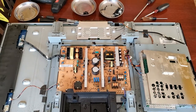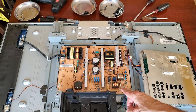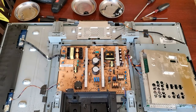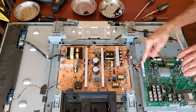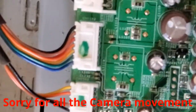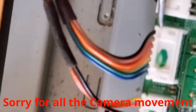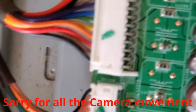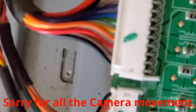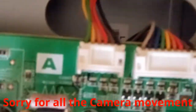Basically this is all the inside of the LCD TV — pretty simple: screen, big motherboard, power board, and then your board is underneath here. You're going to take the screws out first, and then take these connectors out. Be very careful — all the connectors come out the same way. I used a small screwdriver, push a little bit and then twist it. On the other side, be careful pulling these out — the little prongs are very delicate. I actually bent one and had to straighten it out. You can't fit a square peg into a round hole; they're all different sizes.